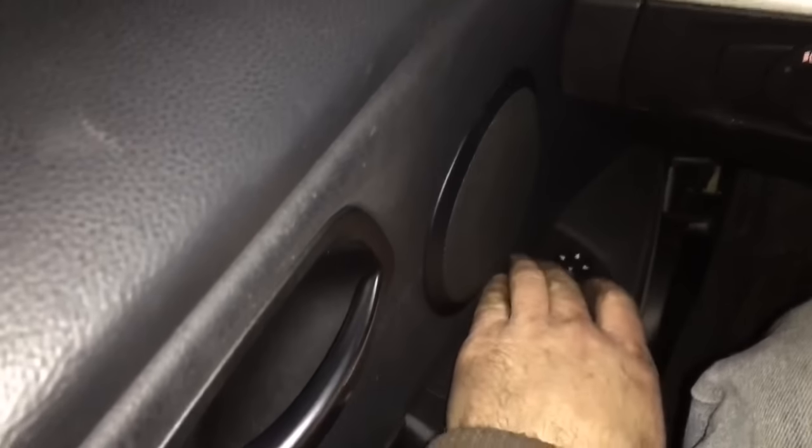Be sure to cycle the mirrors at least 2 times so that if it is off on the step piece, it will reset itself and it will be good to go. So don't worry if the first time it does go all the way out, because if it is out of position, it will readjust itself.